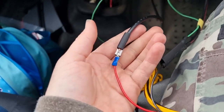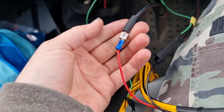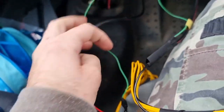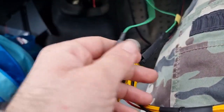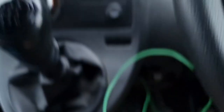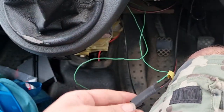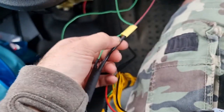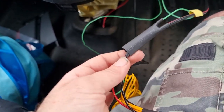A live ignition live — that's all I've got here. So you've got your live, your negative, and your horn button. Horn button, a negative to the button. And then a negative also, from this negative, to a ground on the van or the vehicle you're fitting them to. Easy peasy, lemon squeezy. Remember, you need an airline as well. And that's the short and curlies of it.